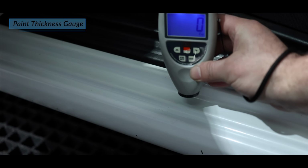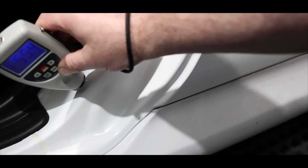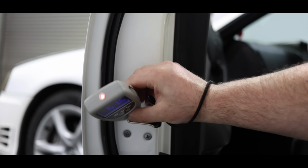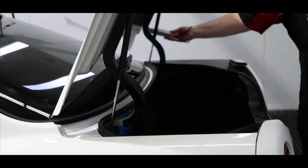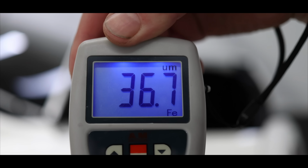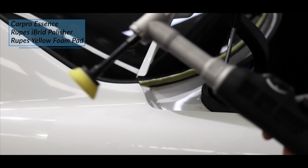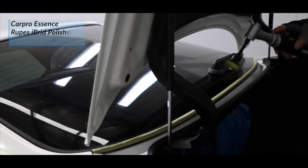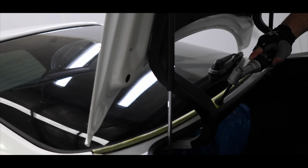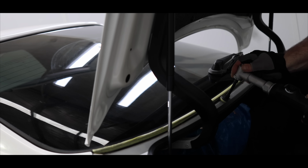As I've mentioned in the past, door jambs typically have very little paint or clear coat applied. So correcting them like you would car paint is generally off the table. But a super light polish with a non-aggressive pad will be safe and will help restore some gloss and clarity, and even more so, further help deep clean them to remove some staining or blemishes that cleaning chemicals alone can't always remove.